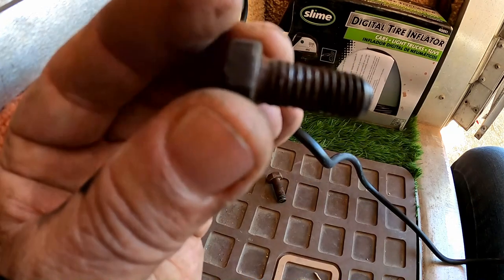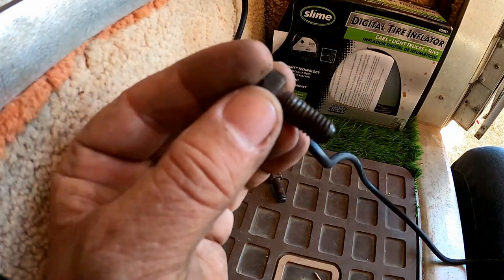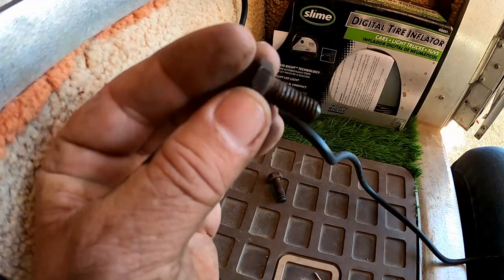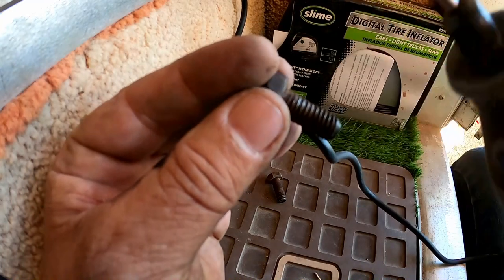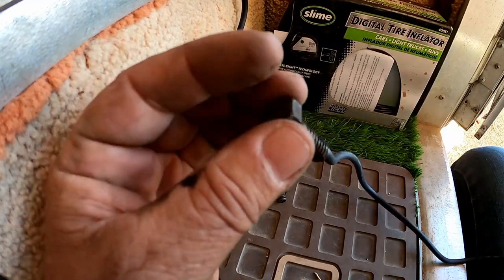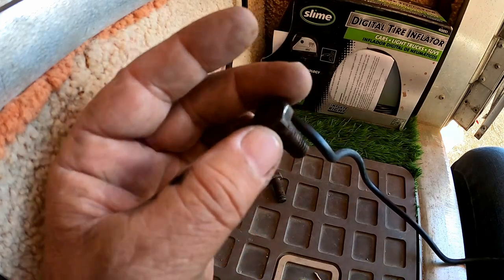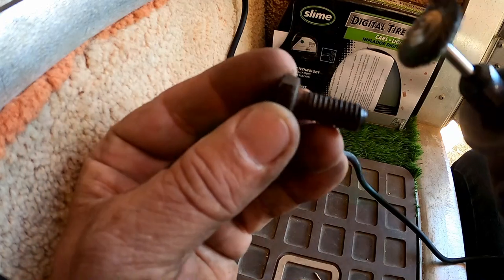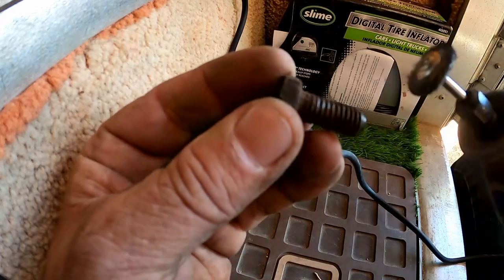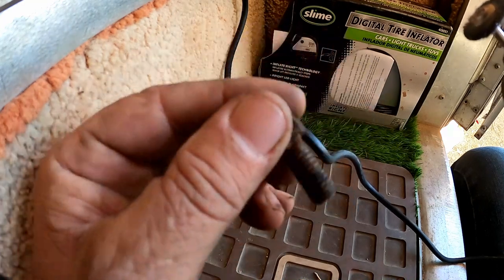See, what happens is with all that debris on there, you say, oh, that'll be good enough. And you run it in, and the bolt acts half tight because there's interference. That debris interferes and the bolt doesn't spin in freely. It's kind of going in tight because it's pushing debris. There's interference and it's just tighter than it seems to be. You get it in there and you say, oh, it tightens up a little bit more. Kind of feels like maybe it tightened up when really it didn't tighten up very well. Half that tightness you're feeling is that interference. Did it really tighten down what it should have? You understand that? You get that?